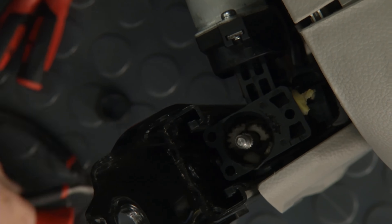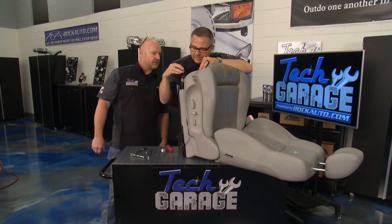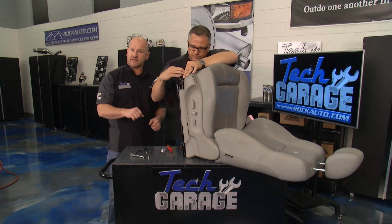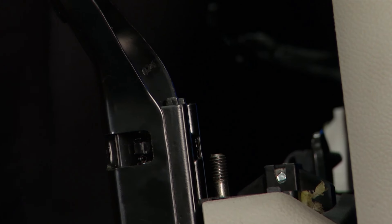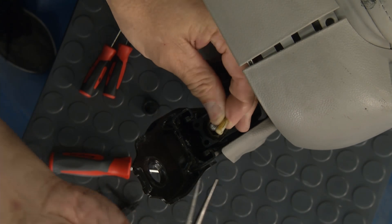Wow — you can see that? Actually, I can probably just go in there and they're all... now, this is common. These are usually — yep — plastic gears. I'm flinging them around as bad as they're broken. This gear would have broken — it probably got loaded up, something got jammed under the track, somebody tried to force the seat. Passenger side was working; John's right leg would go forward, left side wouldn't move. Look at that — there's your surgery.